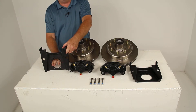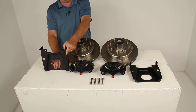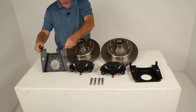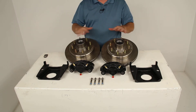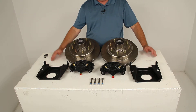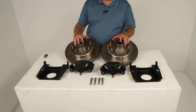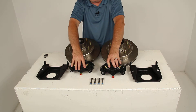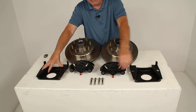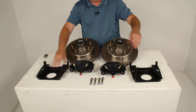This is a 5-bolt brake flange mounting configuration and it is a bolt-on plate, though you can get a weld-on flange sold separately. This part number includes everything shown here for two full brake assemblies: the two machine-finished cast iron hub and rotor assemblies, two E-coated cast iron calipers, two E-coated iron caliper mounting brackets, and four stainless steel caliper bolts for attaching the caliper to the brackets.